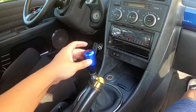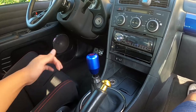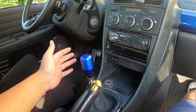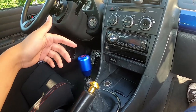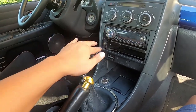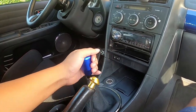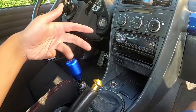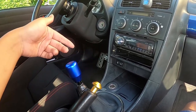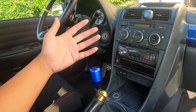Last but not least, I would change your shifter bushing. Right now there's not much play, but before it had a lot of play — trying to find the gear was pretty hard, especially when banging gears going from third down to second. If it's loose you're gonna either miss-shift or not fully engage the gears. I really recommend changing your shifter bushing or even upgrading to a short shifter. It's going to enhance your driving, and once you get more aggressive you can just bang gears without worrying about missing one. If you miss a gear and accidentally go to the wrong one, you can redline and blow your engine. It's only like five to ten dollars — there's no reason not to do it.